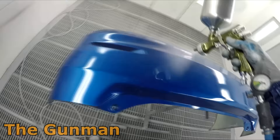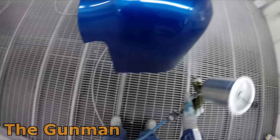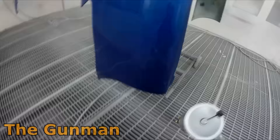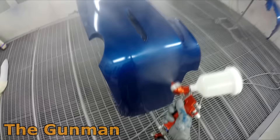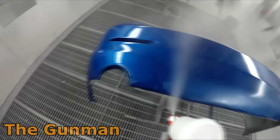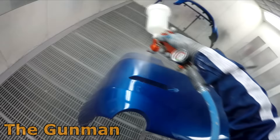There's only one other gun that really comes to mind that I've given an absolutely terrible review, and that was the Star S4000 full-size spray gun — again 1.4 mil, same fault, fan was just way too small. I've got another painter who works with me, around 55-56 years old, who uses a Star S4000 for base coats. I keep telling him he needs to upgrade because it's why he gets a bit of mottling and goes through more material. Switching to the Sata 4600 for clear coat, I'm able to move a lot closer to the panel and move quicker — it actually floods out some of the orange peel from that first coat.